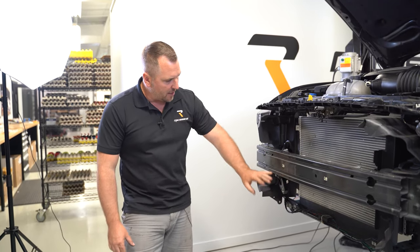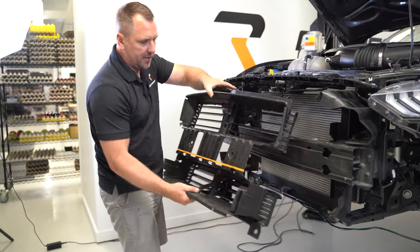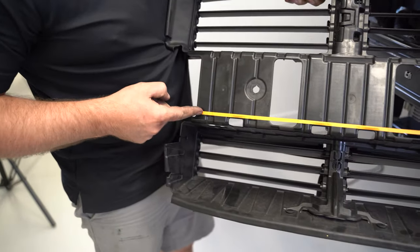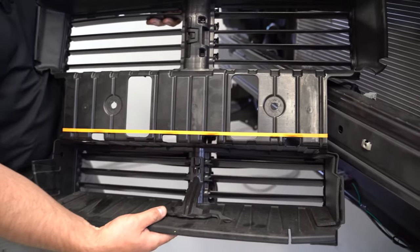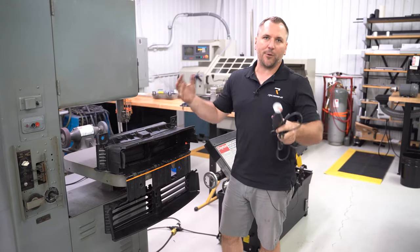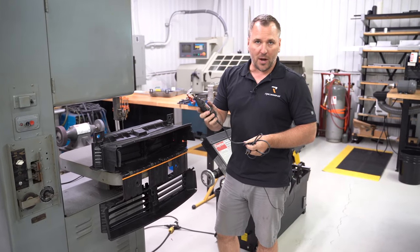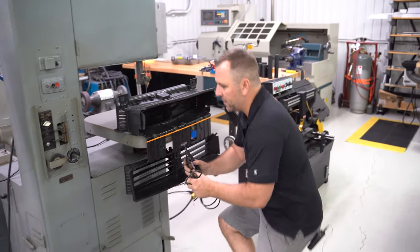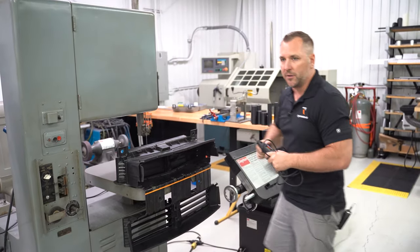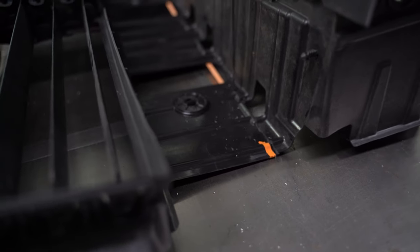The tow mount comes below the crash beam where the bottom air vent system goes, so you can't put the full air vent back on. What we suggest is marking the bottom edge with a piece of orange tape, cutting along that tape line to drop off the lower part, and then reinstalling just the upper section back onto the car. If you don't have a vertical band saw, use a dremel with a reinforced metal cutting wheel to guide yourself along the top edge of that line.